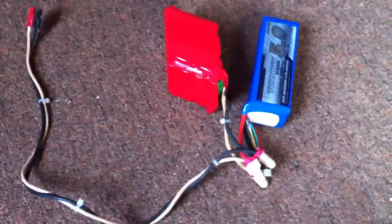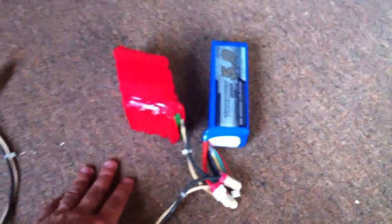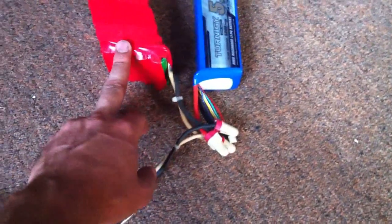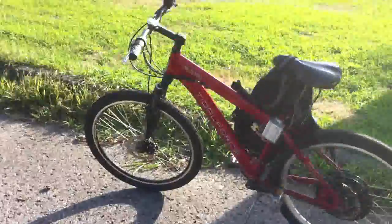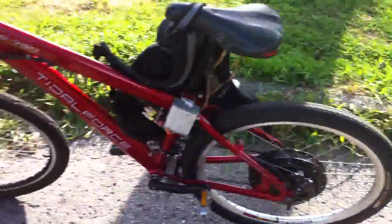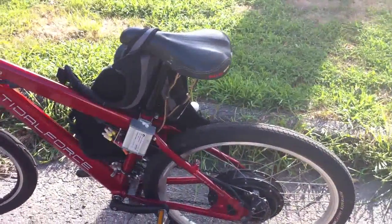There's one of the scary packs I'm going to go out and ride with. It gives me energy and it'll work, but it's not the prettiest thing. You really don't want to be doing this — it's all right if you monitor them, but you've got to be careful because these cells discharge at 5 to 10 amps max, and this LiPo is rated at 30C. So when they're in series, the LiPo is going to drain so much quicker. These 18650s could get damaged if you don't watch them, because all the amps are going to get pulled out of this pack and the voltage will sag — say down to 13 volts — while the LiPo will have a higher voltage. I also put my old seat back on, which let me adjust the angle to a more comfortable position. I wasn't fond of the seat that came with the bike — this old one from my GT Avalanche is much more comfortable.